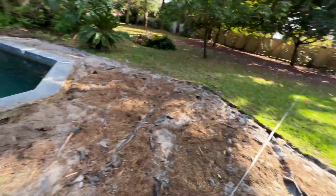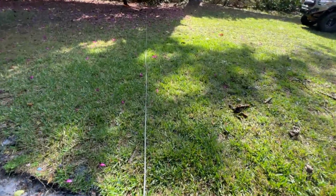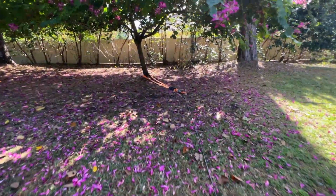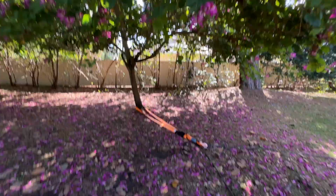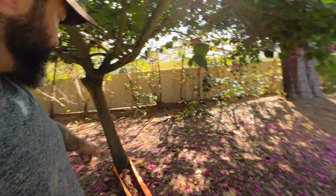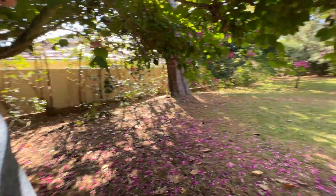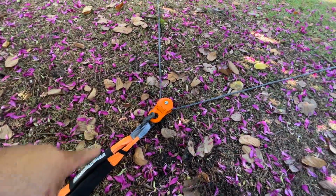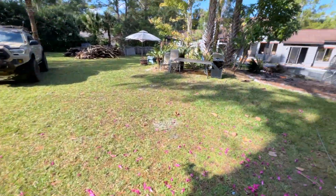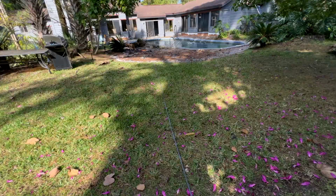And then if we follow the rope back, I am tying into this tree right here, which you can see it's a beautiful tree. I can't harm this one. My wifey will kill me. So we're tucked in low because I want to make sure it pulls from the lowest part, and then snatch block to a D-ring, back over to the truck. So let's see how this goes.